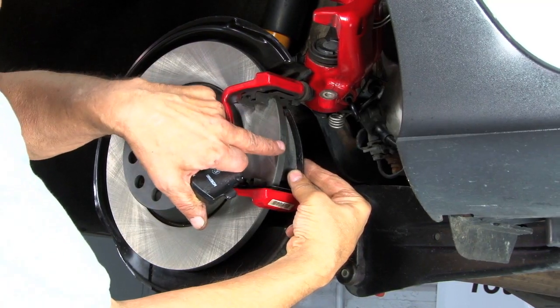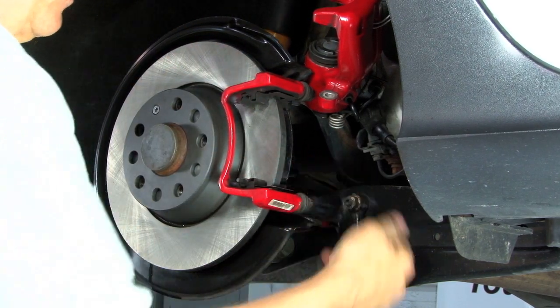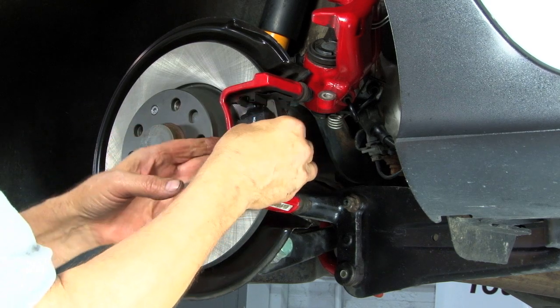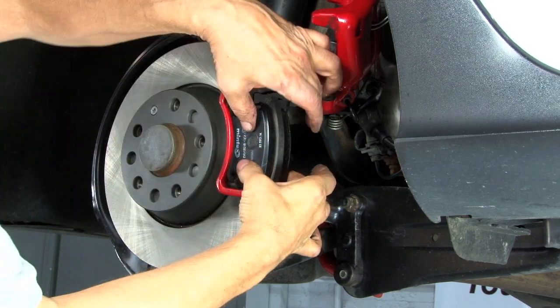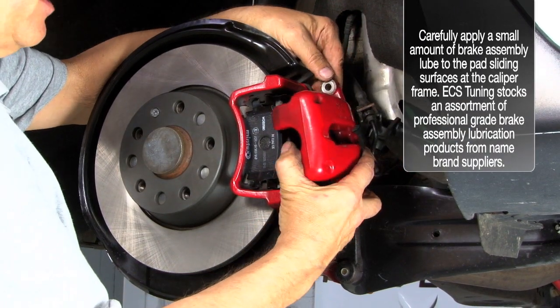Now we're going to put the brake pads in. We've got the caliper frame in and tightened down. Take your rear pad, slide it into place. Take your front pad and slide it into place. Now we'll reinstall the caliper over the pads